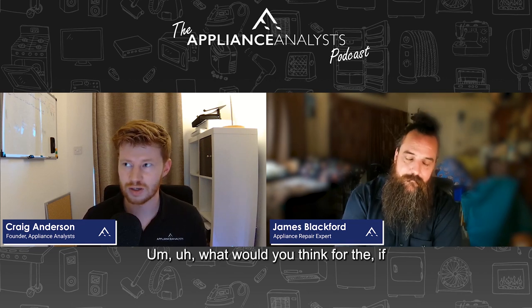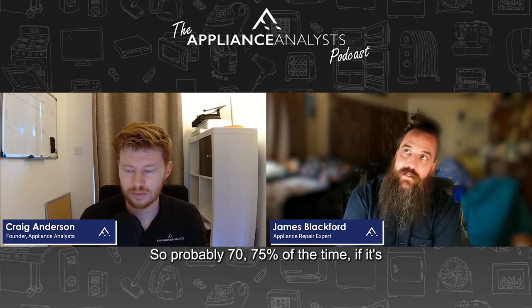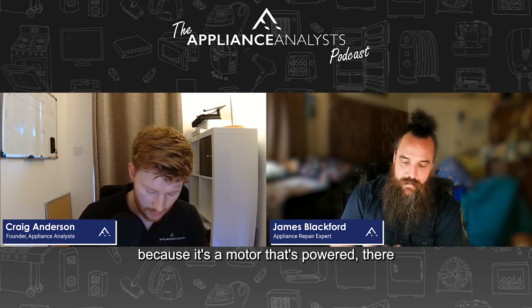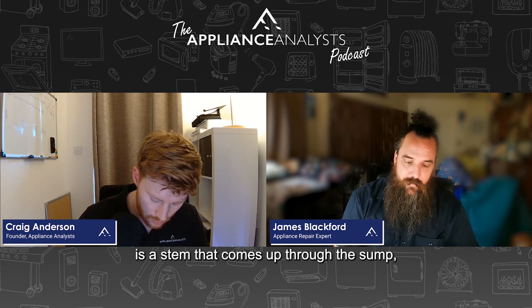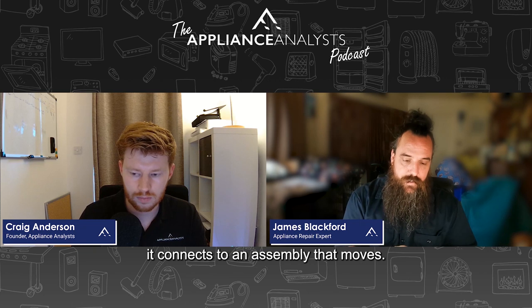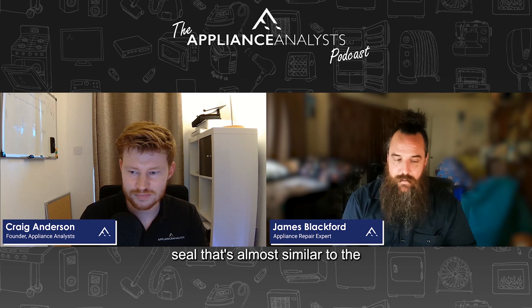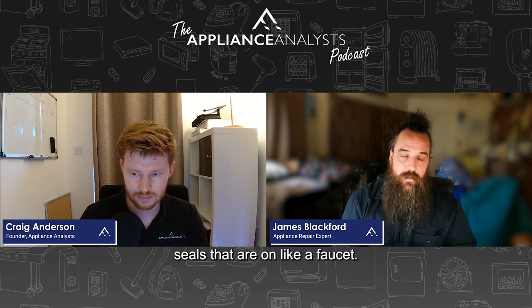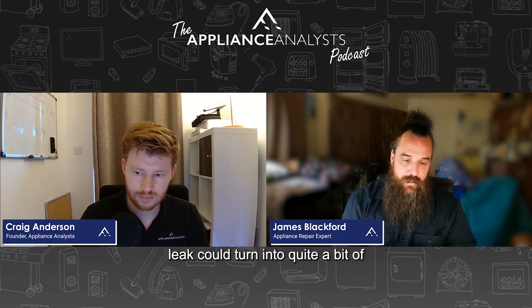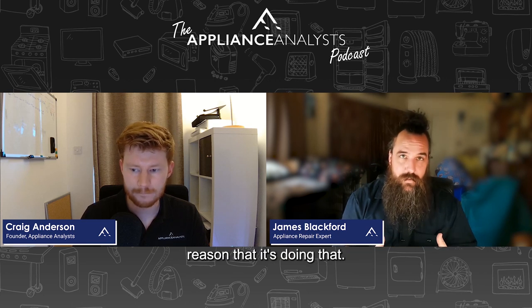Definitely. What would you think for if it's coming from the bottom and not the door? So probably 70-75% of the time, if it's seeping out from the bottom, it's the actuator that we've talked a little bit about. Because it's a motor that's powered, there is a stem that comes up through the sump, which is what holds the water, and then it connects to an assembly that moves. So as it goes through the sump, there's a little tiny itty-bitty seal that's almost similar to the seals on a faucet. If that gets worn out over time, it can develop a leak, and sometimes that leak could turn into quite a bit of a leak where it's going to come out. So most often that's the reason that it's doing that.